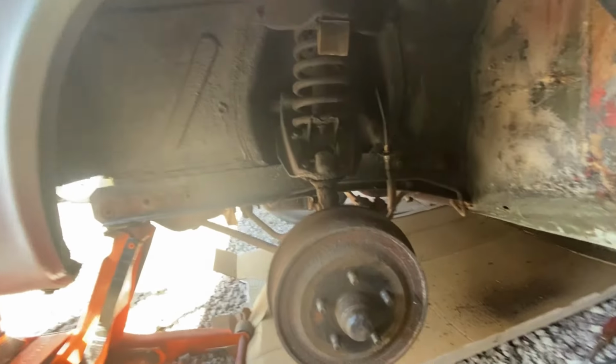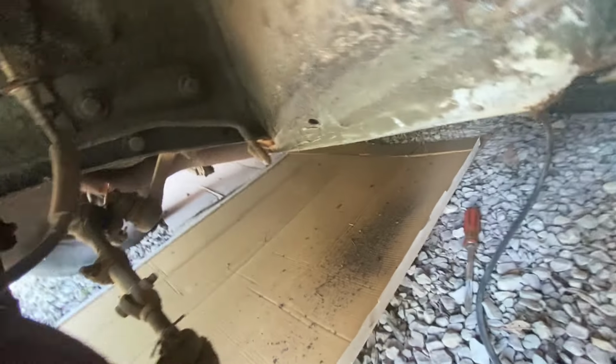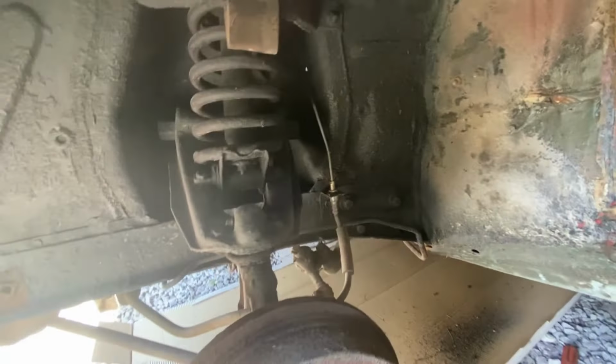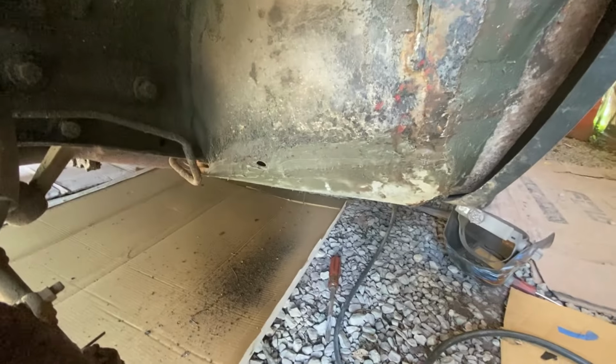So as you see, you got the wheel off, got it welded up, smeared some Duraglass around some of it. Definitely got two torque boxes in it now on both sides. So when we first got the car, we pressure washed the bottom and had him paint it with just some black enamel. But after we get it painted red, we'll probably be coming back with painting the bottom up black again. And I'll get some gravel guard, black gravel guard, flat satin black or something. We'll shoot up these wheel wells again. Clean up the drums, but for right now the welding's done, and that was the point.